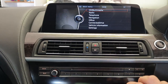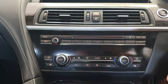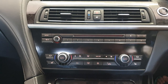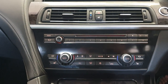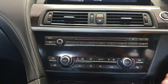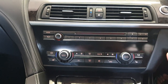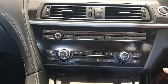Removing the head unit itself is really simple — it just sits behind the climate panel, you take it out, it's got a whole slew of connectors for the various antennas and then the quad lock. You take the optical out of the original harness, place it into the harness that comes with the head unit, connect the two up as a T, and basically just push all the cables back. In the 6 Series the space behind the CIC is cavernous, so finding a place to put the cables really isn't all that tough.